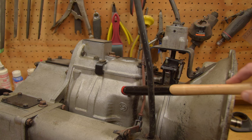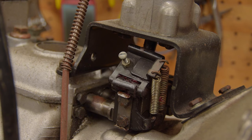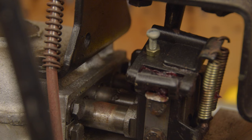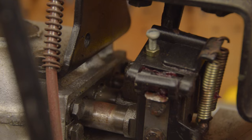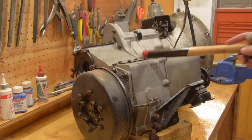This lump in the middle, proudly displaying the best of British symbol, is the main gearbox. This piece on top houses the gear selector shafts. The spring contraption is Land Rover's complex method of making reverse gear feel more springy. The other two shafts are first and second gears, and third and fourth gears. I'm showing this stuff moving now because it gets a bit tough once the gear lever is gone.